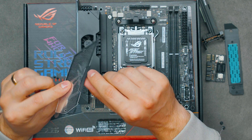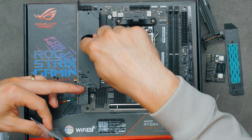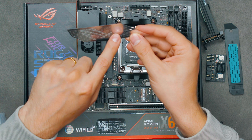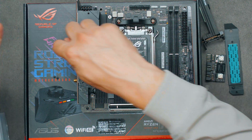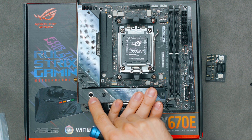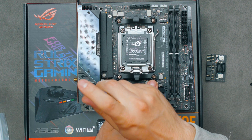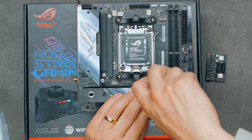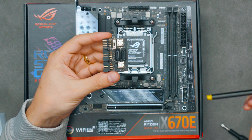There is a CMOS battery attached here as well. Let's look underneath this heatsink — it's just a little plate with a rubbery side. There's another tiny fan that takes air intake from the top through the ROG logo panel, which is actually see-through for airflow. It sucks air in and blows it down and out from the other side. Conveniently, there's a hole in the heatsink so you can put a screwdriver through and install the M.2 underneath without removing all the heatsinks.